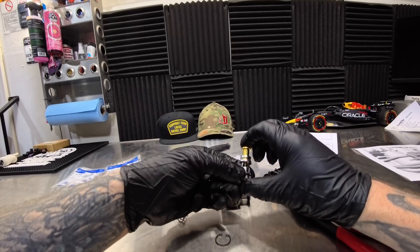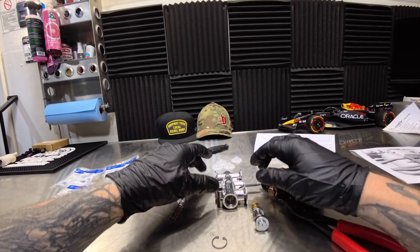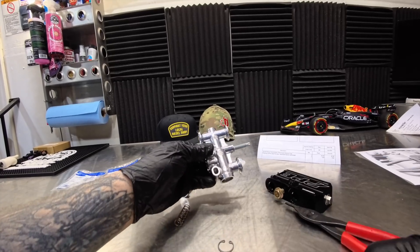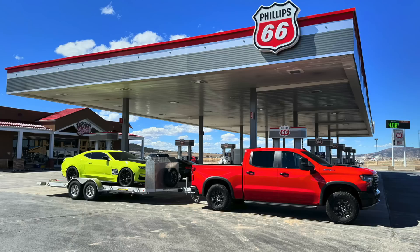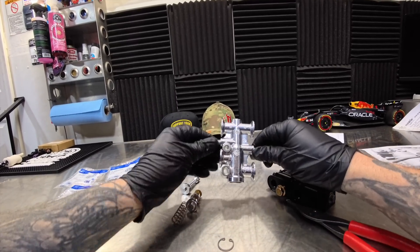The issue that I have is the fluid has to travel through this, so there's quite a restriction on there. And the reason why I don't like that this opens at 196 degrees is because if you're towing and you need to go up a big grade and you're already sitting at 200 degrees, that temperature on the transmission is just going to continue to climb.